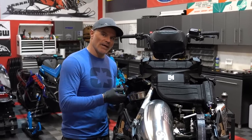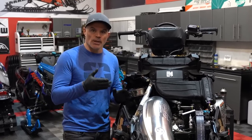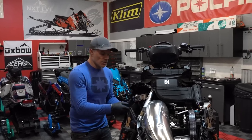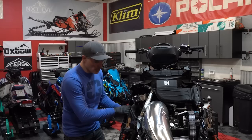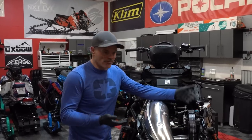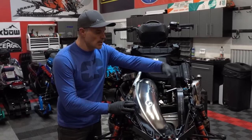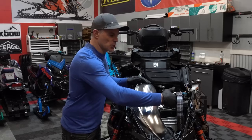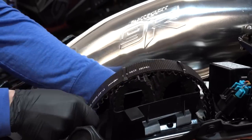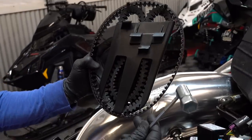In terms of luck, when you do have a spring break off and that's where it ends, that's a bummer. Beyond the dealer's responsibility, it's our responsibility as well, especially as a mid-season checkup. Making sure that all the things within my belt caddy are organized — I've got my clutch belt inside the caddy, spark plugs, and my quick-drive belt. It's zip-tied on the bottom and on the top so it has no way of moving and can't work its way off and touch the pipe. That's a great way to lose a couple hundred bucks, so I take care of that.